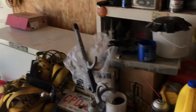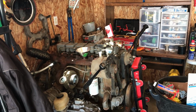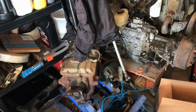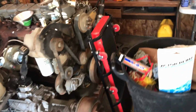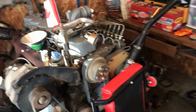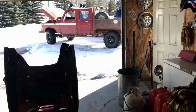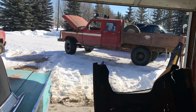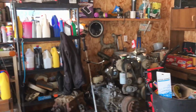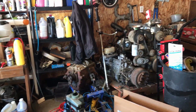So it's been sitting here forever because I came to a standstill. I was doing the math on the gear ratios and everything, and with some tuning to the pump I might get 2,500 RPM out of this Cummins. And with that transmission and the 410 gears in the truck, I'll still struggle to maintain highway speed. Like that motor will be screaming all the time, and that's not a good life for it.